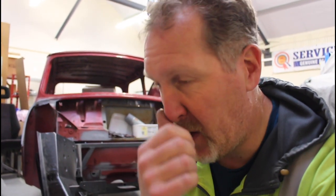We've put the all-speed subframe on the front just to see how it fitted - it was pretty good actually. It was only one hole in the floor that needed a little bit of enlarging. We've also been looking at the inner wings and how they fit around the frame, and we've come up with some ways to alter that from how it shows in the all-speed guide.